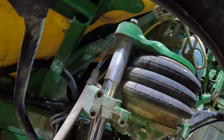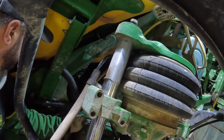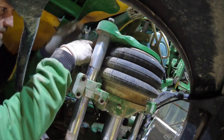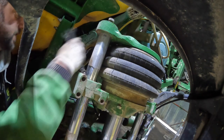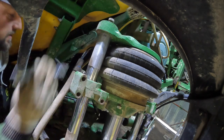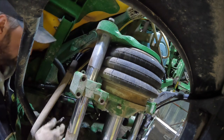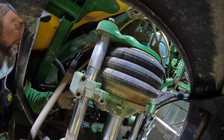Next thing on my list is to take this big bracket off. Grumpster's got my ratchet spanners somewhere. I just keep plodding along taking bits off. I've got to take this bracket off, then pump some air into the airbag, and keep tapping so it comes off. That's one bracket off — I might draft in Grumpster just to tap and not hit that. This bracket just holds all the air compensators on — that is a 10.